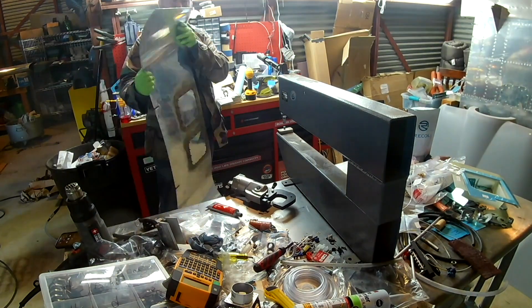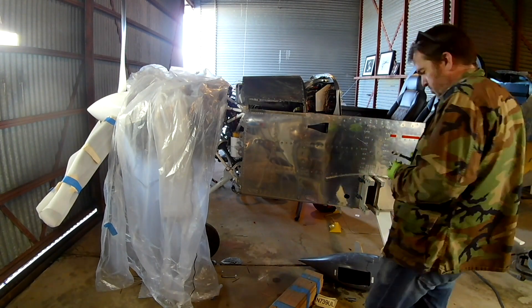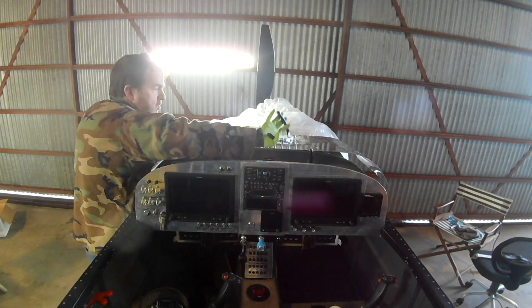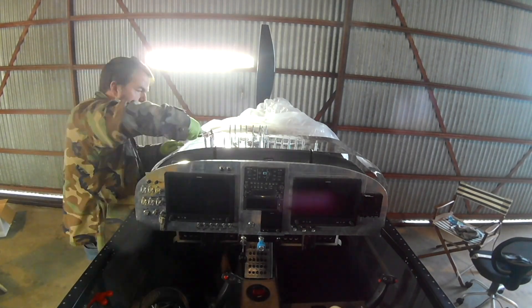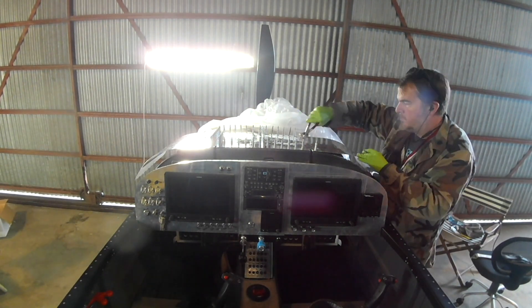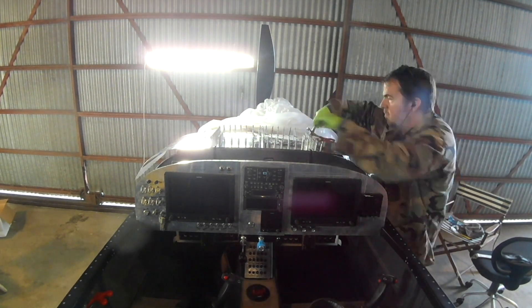Before this skin can go on, the important thing to talk about is that we are doing cam locks, not hinges. Standard RVs use piano hinge around the entire firewall and canopies — here we are using cam locks. Make sure to watch all the way through to the end because you're about to see me doing something very stupid. We've got to put the cam lock flanges in place when we're putting this skin on, and as I'm doing it I noticed one flange looks like it's coming a little too close to the secondary battery — really really close.